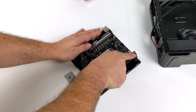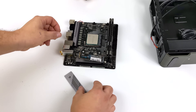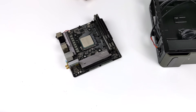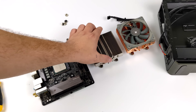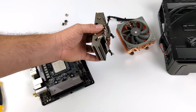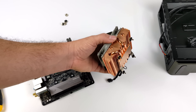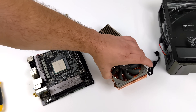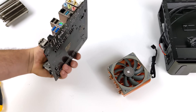If you want good performance you need faster RAM. This is 16 gigabytes of Patriot Viper Steel running at 4400 megahertz. If you wanted to go a bit cheaper you could get some 3600 megahertz RAM and overclock it from there — probably up to around 4000 megahertz depending on brand and model. Now keeping this APU cool in a small form factor case can be a challenge, but Thermal Right offers some decent coolers. The AX90 is lighter and all aluminum, while the AX90i has more mass and a copper plate. That's the one I'm going with for this 5700G build, and I opted to use Noctua NT-H2 thermal paste.